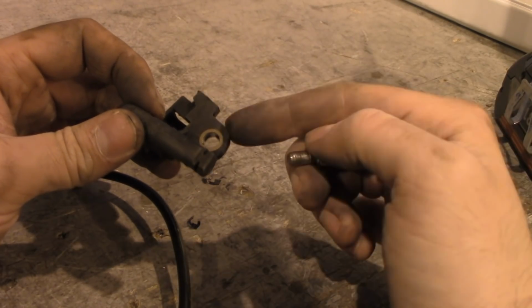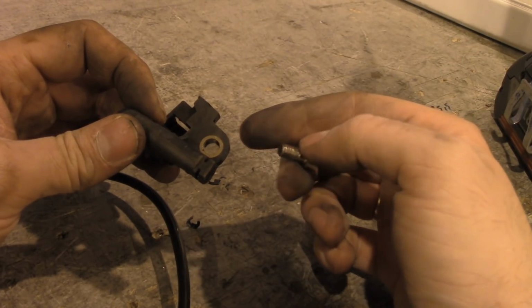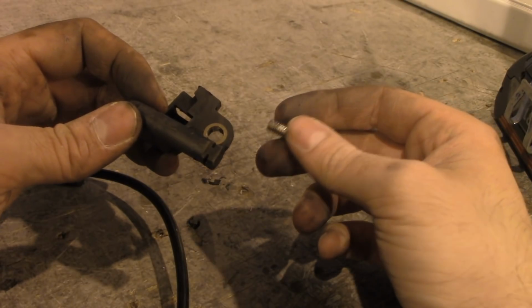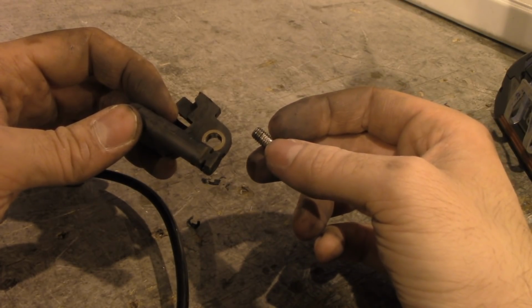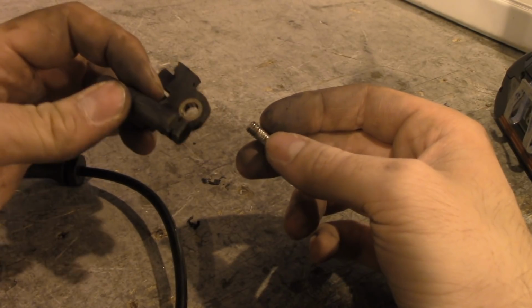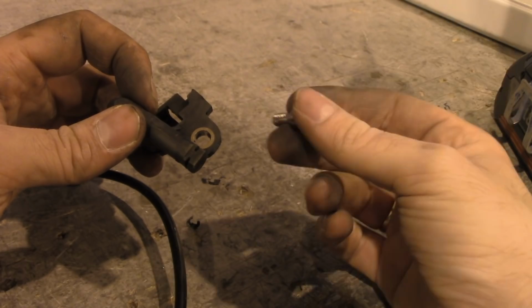position. In the perfect world, if I hadn't been redoing the hole and threads in the material when I replaced the previous ABS sensor, I probably had the exact great spot to use, but I believe that 0.5 millimeter is not enough, and that heat expansion would destroy the sensor. So I will need to add a spring washer to prevent untightening of this bolt. So now, as you see, I increased it to a decent millimeter or a bit above. Well, I would say a millimeter is what you can see here. And this is what I wanted.